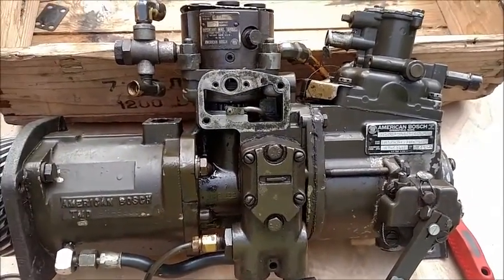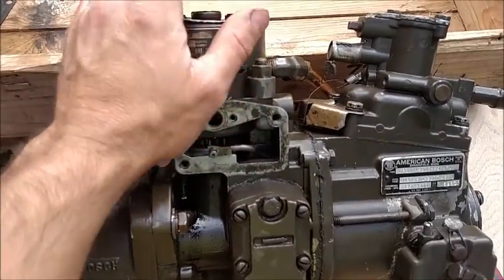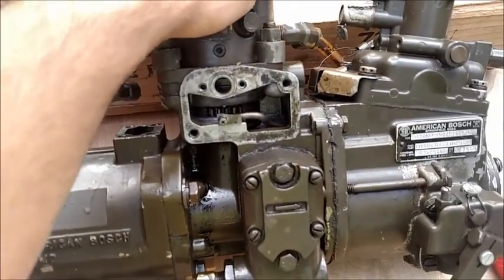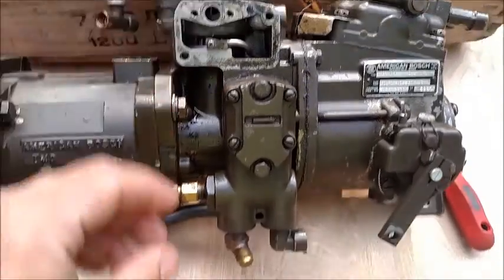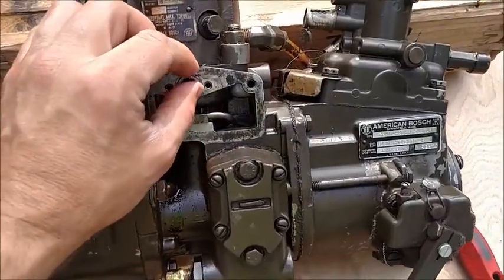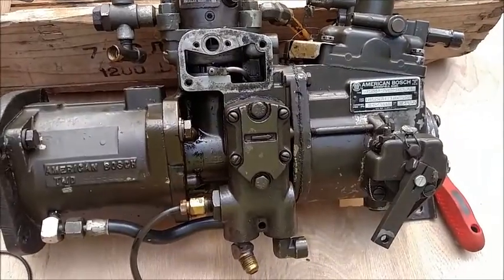But point two, especially with these older motors, this head requires oil, diesel oil. Diesel is still considered an oil to lube all of the moving parts inside of it. This shaft requires oil and diesel to flow through it, through the fuel portions, to help lube it up.